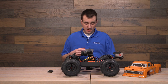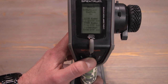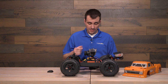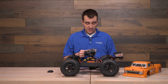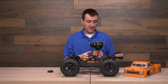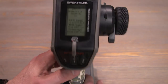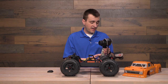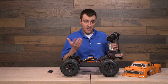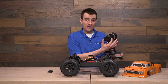While we're on this screen, here's one more quick tip that's going to help you a ton when you're out bashing. I still have my steering at 0%. I'm going to move over to the setting that says OTF — this stands for on the fly. You can assign any switch on the exterior of the radio to adjust AVC at any time. I'm going to select this and bump my D trimmer, which is over here. One more thing: I need to switch the arrow that says up to actually be down. Now, while I'm on the field, I can control AVC with this trimmer. My numbers are actually increasing as I hold the trimmer up and decreasing as I hold it down. So now I don't even have to go back to this menu to change AVC.